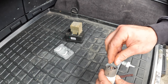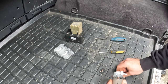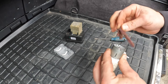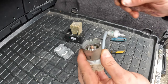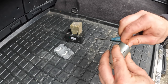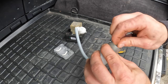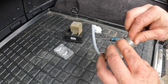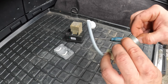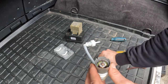I just cut a little piece of red scotch brite. There's a little nylon washer that sits on top — take that off and then you can take your scotch brite and just clean up the copper. You can kind of see it's cleaning up all the black marks off of it. Obviously my pump still worked so this isn't as dirty as it could be — when I first took it apart, this was completely black. So now we've got it cleaned up for the most part, it's good enough.